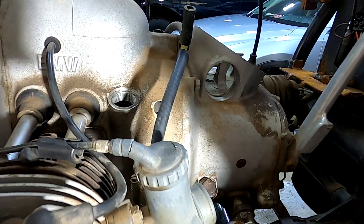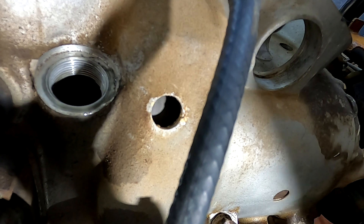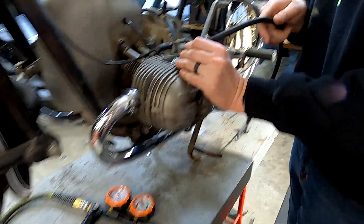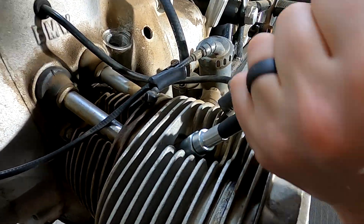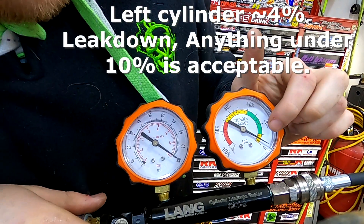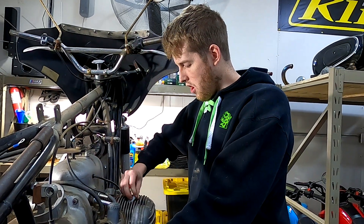Now that we did the right cylinder, we're going to move the wheel all the way around and look for the top dead center mark — the OT mark that I highlighted in blue paint pen — to put the left cylinder at top dead center compression. Let's thread our leak down tester adapter into the spark plug hole, thread this in, and have your buddy hold the brake. On the left cylinder we're at just under five percent leakage.